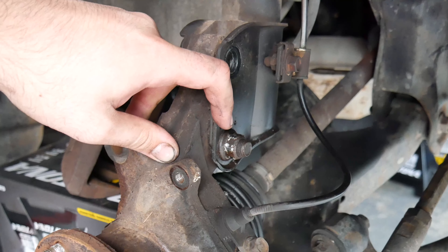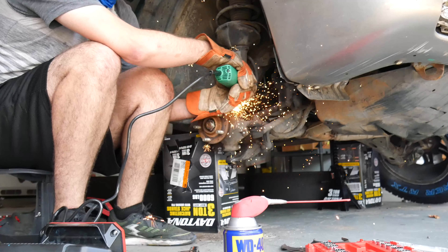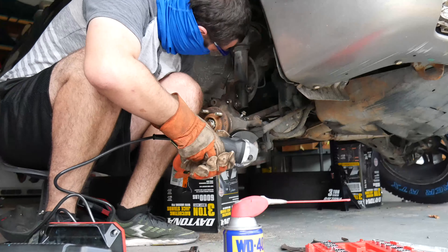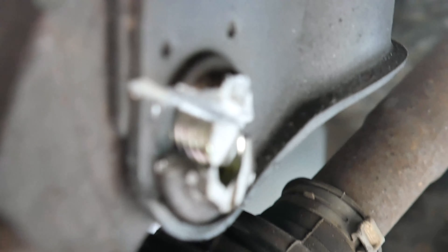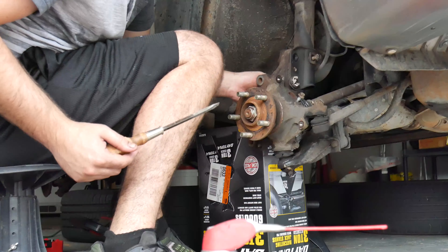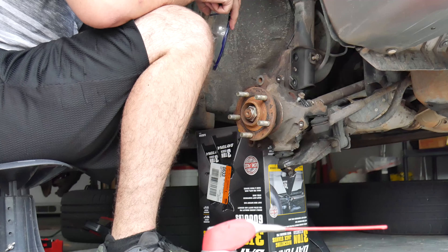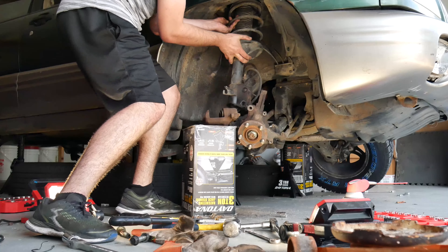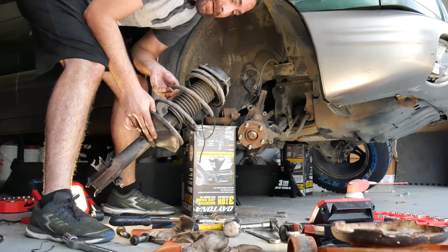I could try an extractor but I was already unable to loosen it with all my might, so that wouldn't help. My only course of action is to cut it off. I've never really used a grinder before, but I bought one and some cutoff wheels. I'm going to be as safe as possible with gloves, glasses, and a mask. I cut at several different angles — it was a little hard to reach — but eventually it started to fall apart. The bolt is off. I can finish this project. I am going to finish this project.